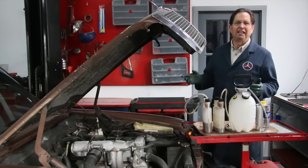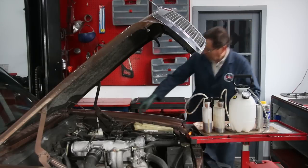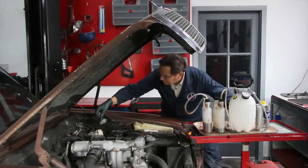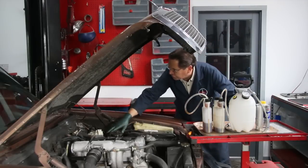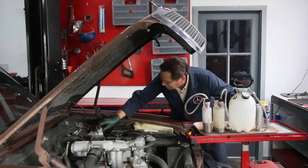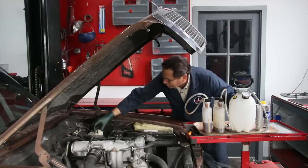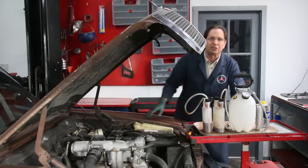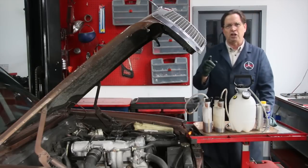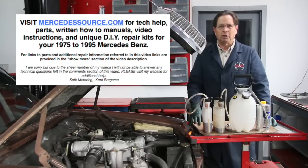Of course we had the advantage of a lift, so maybe we are cheating a little bit. As a final note, go ahead and remove the pressure bleeder cap, double-check that the reservoir is at the fill line, then replace the original cap and tighten it down. You can see how clean the fluid is in there — you should have seen it before I started. I highly recommend you do this job, or at least get it done every two years, because it is an extremely important maintenance item on these older Mercedes-Benz, as well as any other car.